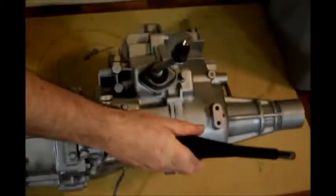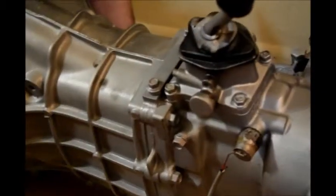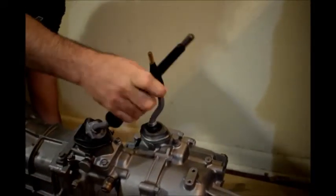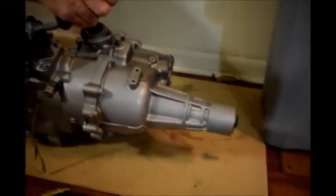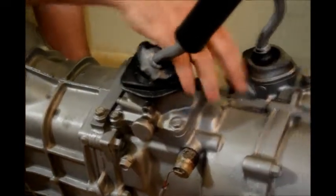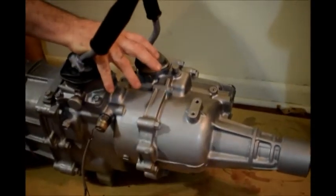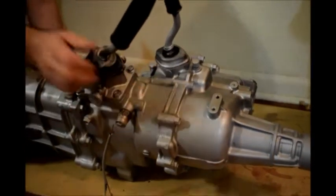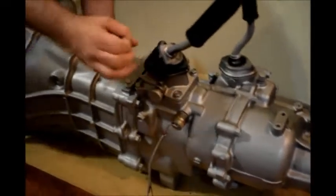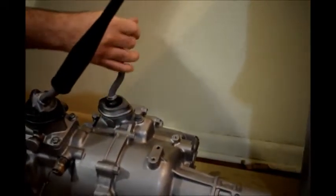So this is your five-speed. This shifting lever is a standard Trooper/truck long-throw shifting lever, which is probably pretty good because it makes contact directly with the fork inside the tranny. But I'm pulling it off — these four bolts here — and I'm putting a remote shifter on it, which puts my shifter back here in the console area, and allows me to use my original console and rubber boot kit. I'll be using a remote shifter that sets it back and uses the same little ball to shift around. I'm going to probably leave these and just paint them black again.